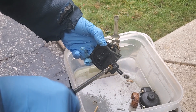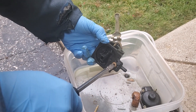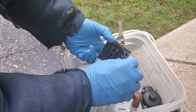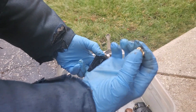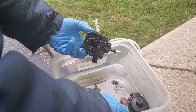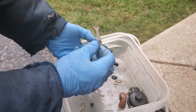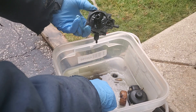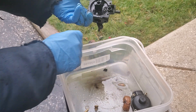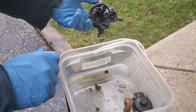And this is where the needle valve goes into — it's just a basic hole, but it's easier to clean like that. There's also a filter screen that goes on the bottom of this, and it was just filthy. Had this blob. Quite a bit of the problem I think will be solved.